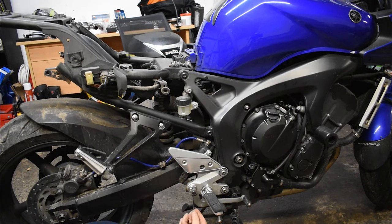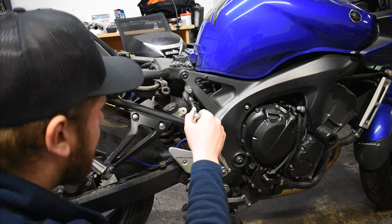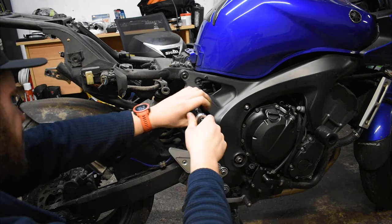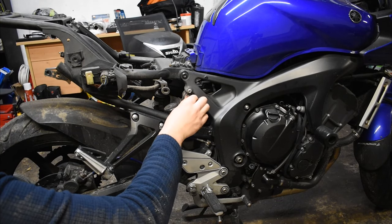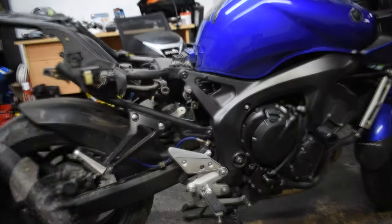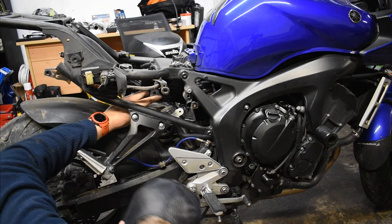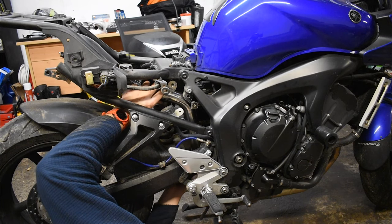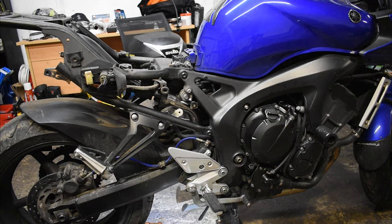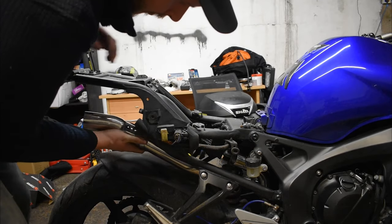To fit the cat delete pipe, you need to remove the lower clamp, the brake fluid reservoir, and that upper bolt. I'd also advise loosening the torx head bolt just above it for more wiggle room when refitting the link pipe. The old pipe was an absolute pile of scrap — someone had re-welded a piece where they removed the cat. The new one is lovely stainless steel and fitment was perfect, lining up with the original bolt holes with very little messing. Then tighten back up the lower clamp, the top bushing bolt, and refit the brake fluid reservoir.